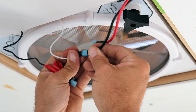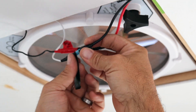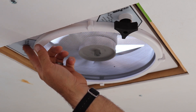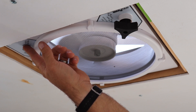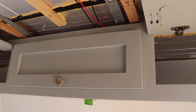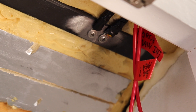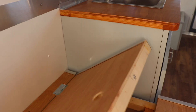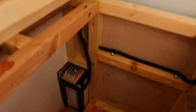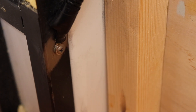Here's a quick look using those same spade connectors to connect my ventilation fan. You might notice the wire colors don't exactly match up, which is why I have one of them labeled pretty prominently — I've found that's the case with a lot of these appliances, but it usually isn't too hard to figure out. The grounding was pretty straightforward. I tried to locate all the grounds in easily accessible places. All of the ceiling lights are grounded in the upper front cabinet directly to the trailer frame, and my charging station and 12 volt socket are grounded to a nearby wheel well. I ground off some paint, added a little battery grease, and then a stainless steel self-tapping screw with a ring connector.